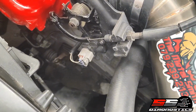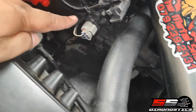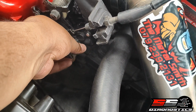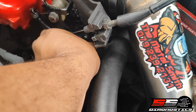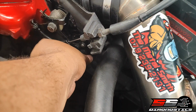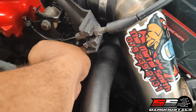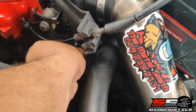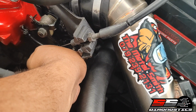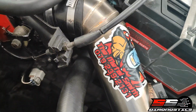Right, so you see there the ICV, that two screws there, right? So those ones you obviously adjust, and then you can see you can turn it either way, but you only set it when the car's idling. So yeah, you can either make it completely up or completely down. We'll just check now. I think it's completely down on the left and up on the right, but we'll just double check quickly and see.